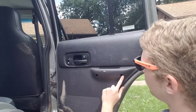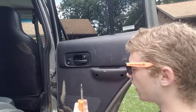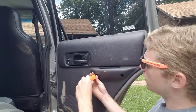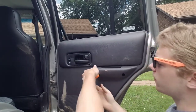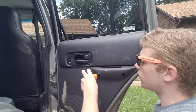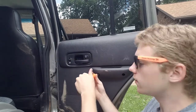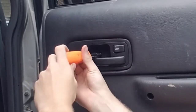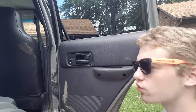First we have to remove the door panel. There are three screws holding it in. I'll be careful because these screws probably haven't been touched in a long time, considering there are no speakers in the back doors. Small forceful twisting motions will usually break them free — push in as hard as possible and just tap and twist. I don't know how to describe it, but I got this one loose. You can also try using peanut butter if you want. Whatever you do, don't strip these — you will have a terrible day.